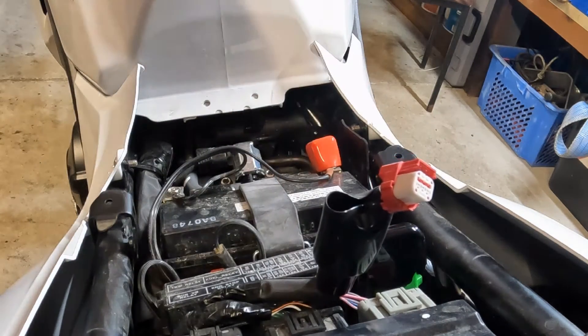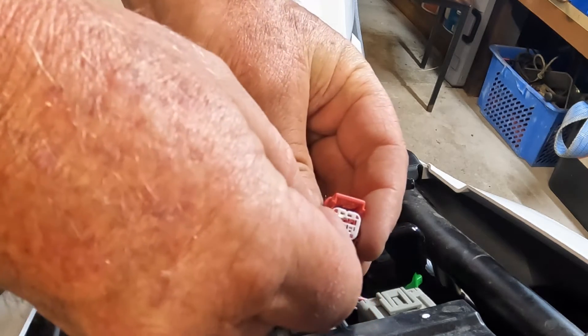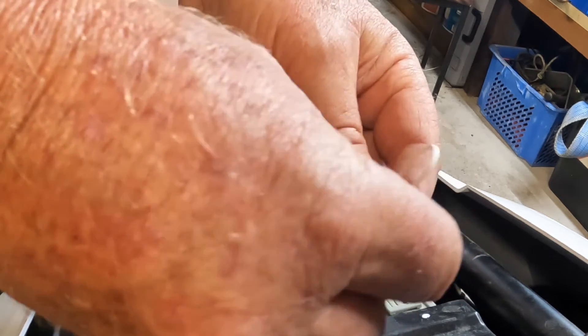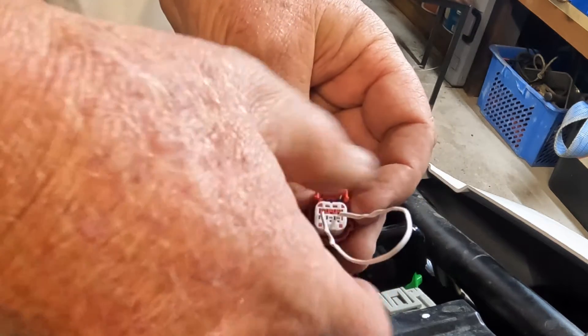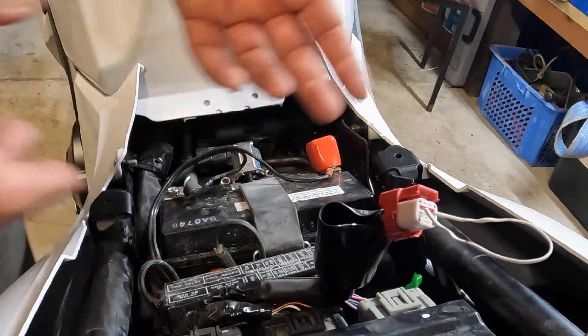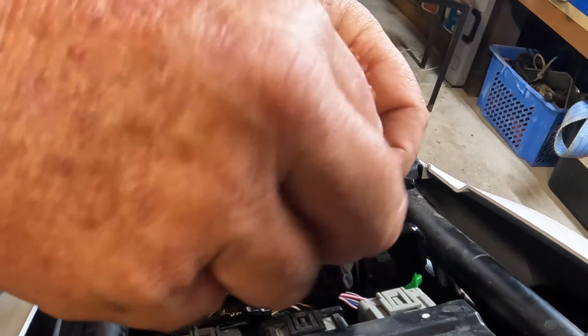Or if you're a gambling person, you can grab a bit of wire like that, bare the ends off, and there are two little ports. You can see this line of red connectors — you go to the outer one, put it in, and the inner one. Outer, inner, like that — connect those two. Make sure you don't slide them down the side but actually in there, and make sure it's got a nice firm connection. Maybe put a bit of weight on it. Then you can proceed with setting up your fog lights and getting it all recognized. It's probably better to use wire slightly thicker than that so it fits a bit firmer.